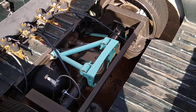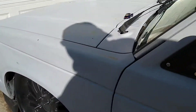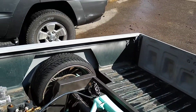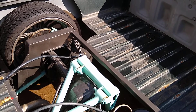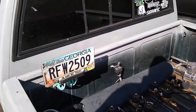Four-link suspension gives best travel from full droop to locked up. Same thing on the front — you've got a bag in place of your coil spring between your control arm and your frame where the coil spring used to be, and that's on both sides. In the rear, you take away your leaf spring, four-link it, and then you have bags that act as springs to lift, lower, and support weight.